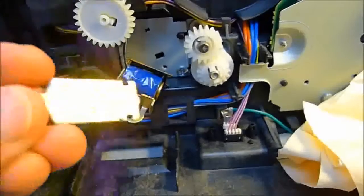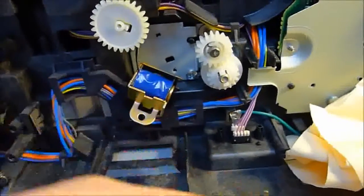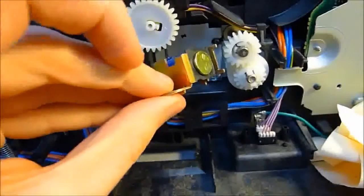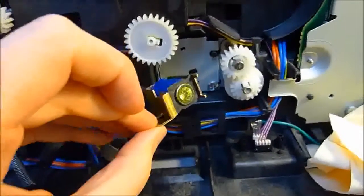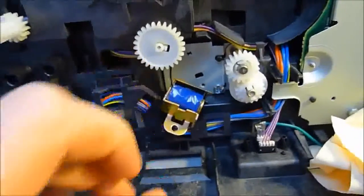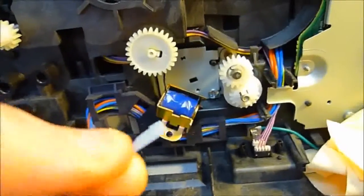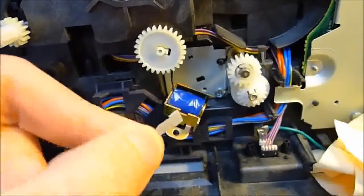As you can see here, we've removed all of the adhesive from the armature of the solenoid, and we've also taken it off the body of the solenoid. We can see how clean that is right there. No more of that black adhesive. Now, while I was doing this, I looked online, and it seems that, contrary to what I said previously, what we do want to do is actually take some kind of piece of plastic or some sort of magnetic resisting stuff and stick it back on the place where the adhesive used to be.